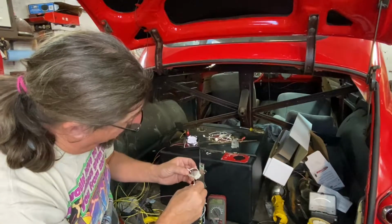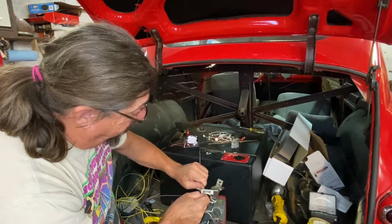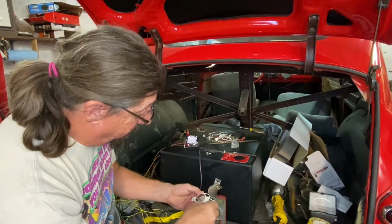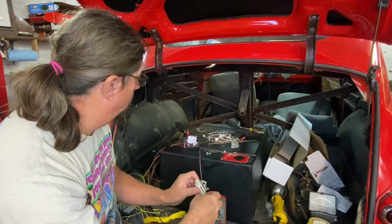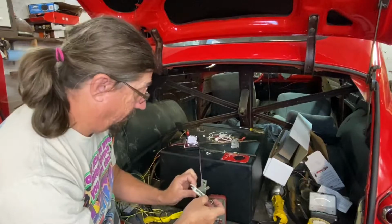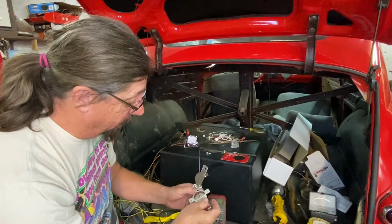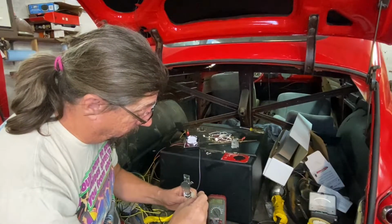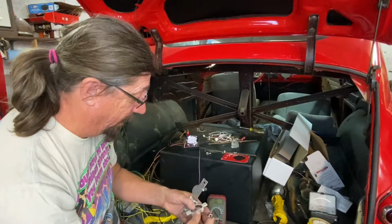And I've still got a little more room on the sweep, so let's pull that out of there and bend it a bit more. I want to be very careful not to break it, obviously. Yeah, that's going to screw me up on the low end, and I know that. Okay, there we go. That's getting me closer to full. Yeah, 7/8 is about as good as we're going to do, and I'm still reading on my empty, so that's good. Okay, let's put it back together again now and see how it works once it's back in position, because everything's kind of flopping around right now. I don't think I could get much more out of it than what I'm getting by tweaking it the way I did.